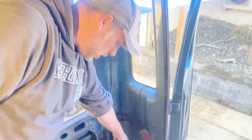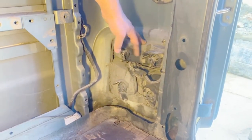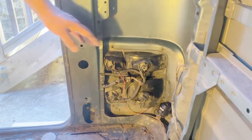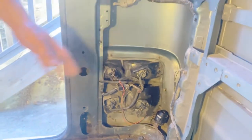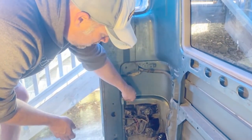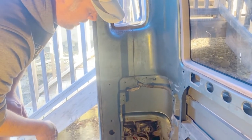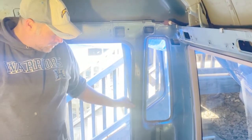The next thing is I'm going to take these lights out as well because both of these lights leak — it's leaking around the seal. I'm going to take all these bolts out, pop it out, and do something with the seal — probably put some new rubber in. On this side and on the passenger side as well; the passenger side I think is worse from what we could tell when it was raining the other day. So we'll pop both of these out, clean them all up, put some new rubber in and maybe a bit of black sealant, just to make sure we're not going to have any more leaks. The rust is really nowhere else we can see, so once we're done here we're hoping that will be about it for the rust fixing.